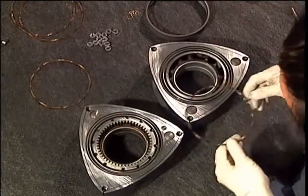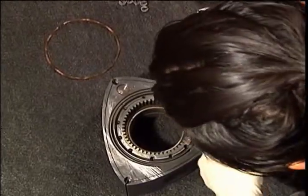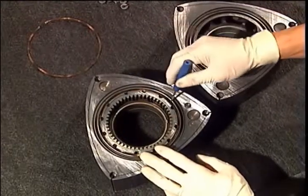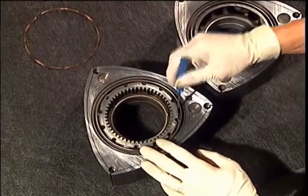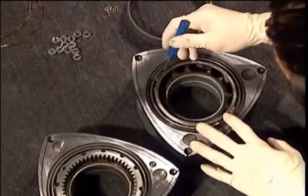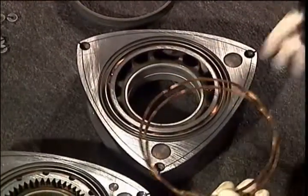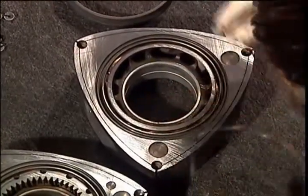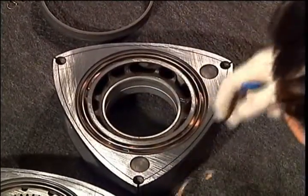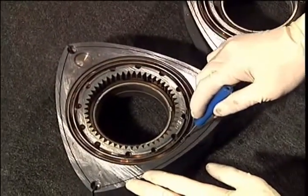With the rotor on the left gear up and the rotor on the right gear down, we are now going to install all the forward-facing oil control rings and springs. You will now pick up your white oil ring springs and, with the round tip on the right hand side, place the round tip into one of the little holes in the rotor. With the outer ring spring, place the ring opening as far away from the inner ring opening as possible, making sure the round tab is placed into its hole.